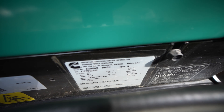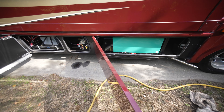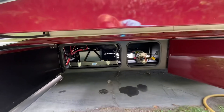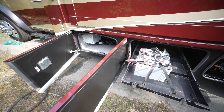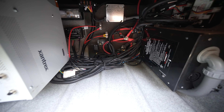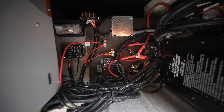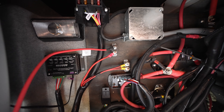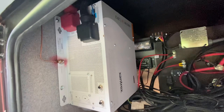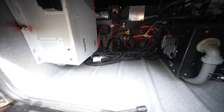Next door, we have our 8,000-watt Onan quiet diesel generator, which is a big plus over the 6,000-watt. The 6,000-watt wouldn't allow for the two 15,000 BTU air conditioners and a lot of other systems that draw a good bit of power. Next door to the generator, we have our hydraulic leveling system and two coach-side batteries on a huge slide-out tray, so you could easily add more batteries for boondocking. Next door to that is an electronics compartment with our auto gen start system, 2,000-watt Xantrex inverter, and on the right an automatic transfer switch with a built-in surge guard — about a $1,200 component that protects from surges.